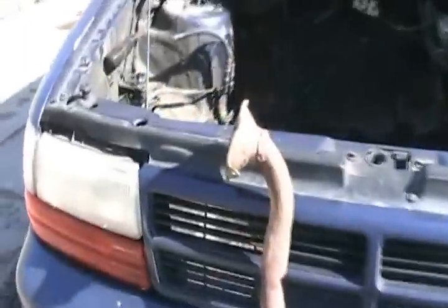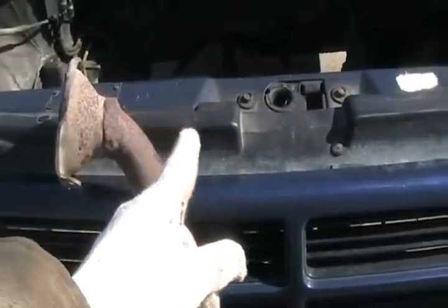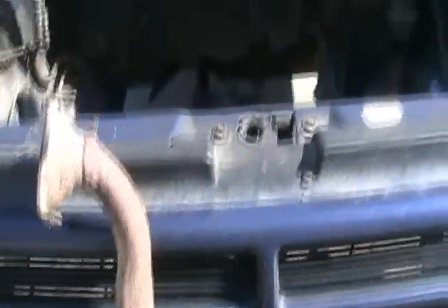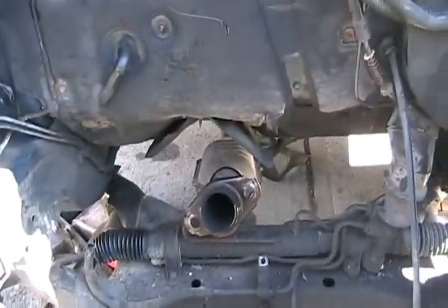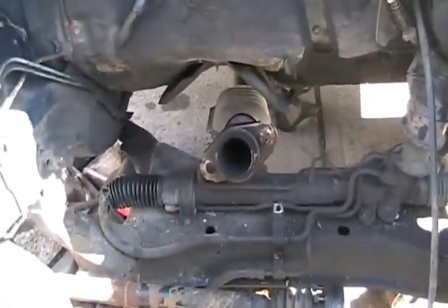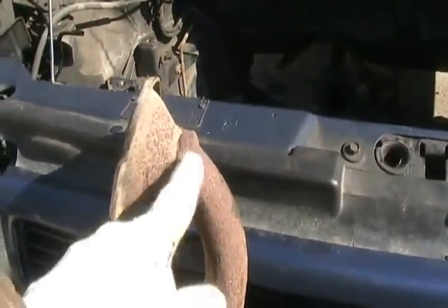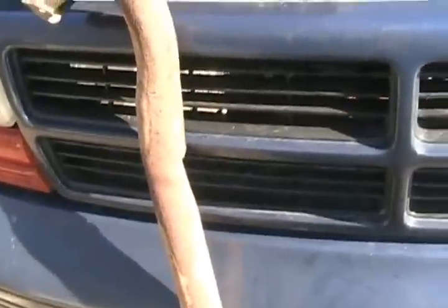There's the part I mean. I had to buy a new downspout, but unfortunately they come with a big curve like this. That doesn't work because there isn't enough space between the rack and pinion to run that big curve down there — it hits the rack. So I cut off the curve, re-welded it all, and since I don't have a tube bender, I heated it up and made those gnarly looking bends.